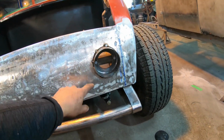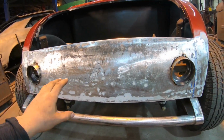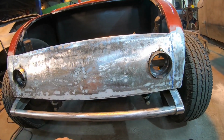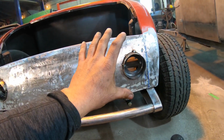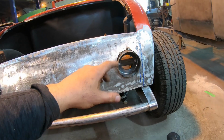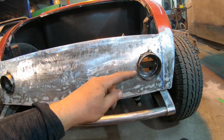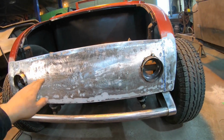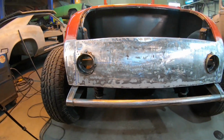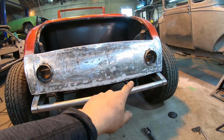However, the tail pan over here is about 3/8 of an inch taller than over here, so I kind of split the difference up, and I don't think it's really too noticeable. I mean, it's about 1/8 inch off, but you have that much more material. So basically I just centered the bucket on both sides, and really I'm cheated up over here about 1/8 of an inch to accommodate and make that happen down what I figured to be the center line of this tail panel. The top side over here is a little taller, and the bottom side is shaped a little different over here.